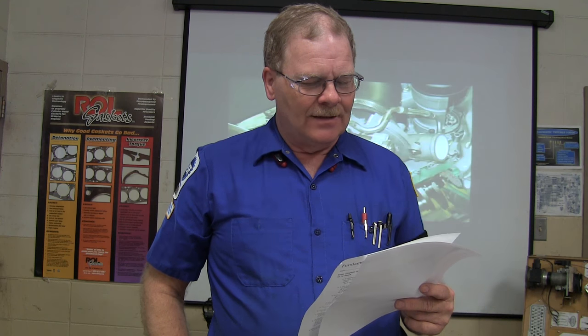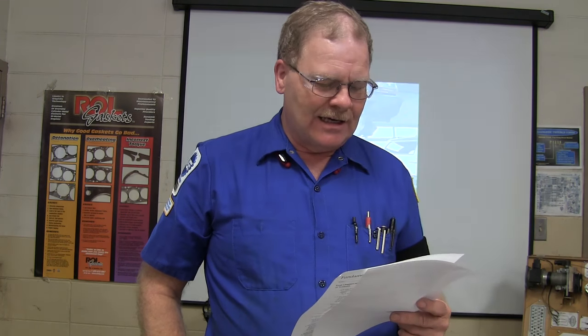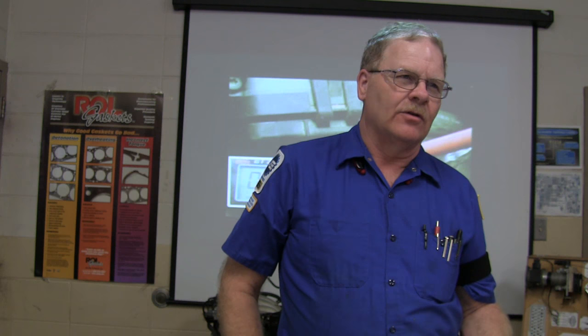All of the above. If you use it in a non-flex fuel gasoline engine, the alcohol attacks the injectors and the lines and all that stuff. That's why I said if you can get a flex fuel car, even if you don't intend to burn flex fuel, you're getting a better fuel system.